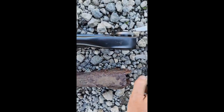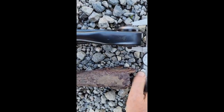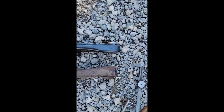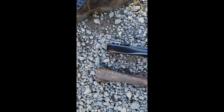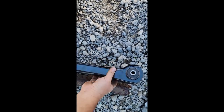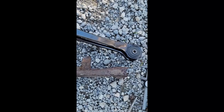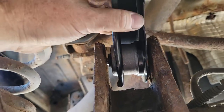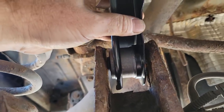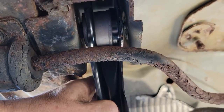Here's the old trailing arm - just under two inches. And this new one is about 20 thousandths narrower. That ought to make for some nice rattly noise. These people are so proud of their product that there's no name on it - no name on the box, no paperwork, nothing. Just says 'trailing arms.' Only the finest quality.